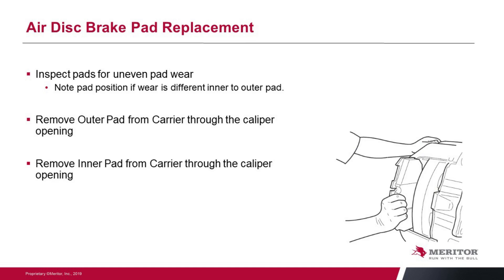As a rule of thumb, we recommend that when you're working on a unit you remove the outer pad first. That will allow you to push that caliper back and make a nice big opening to take out that inner pad. Because where the inner pad sits is also where you have your boots — your piston boots and your slide pin boots are located in that area, and that gives you more freedom of room so you're not going to cause any damage to those boots.